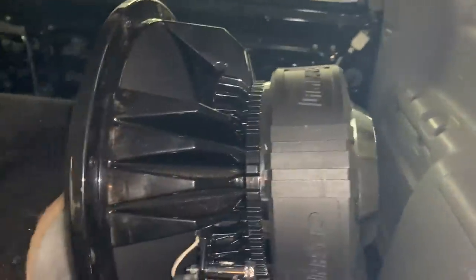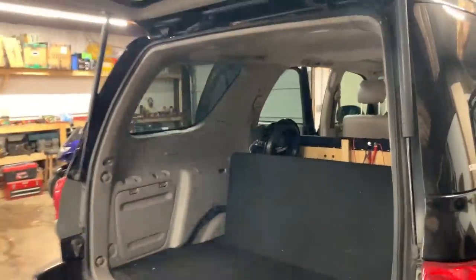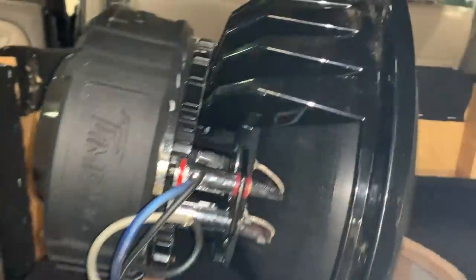We made it to three minutes, but this thing is hot — we're getting a little bit of smoke. Okay, we're going to turn it down really, really low and let that cool off. Going to 20 hertz. It got hot as can be, but it is still going. It does not appear to be actually blown. If you're really pushing your subs and get them really hot and start to smell it, if you instantly turn it off, that can trap all the heat around the coil and cause coil failure. What you really want to do is turn it down real low and play something at a really low frequency. The low frequency moves a lot without having much power going to it, so reducing the power cuts down on the heat, and having it moving more helps push air over that coil to cool it down.